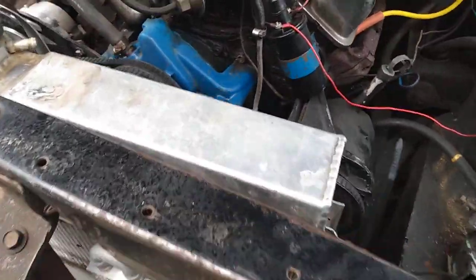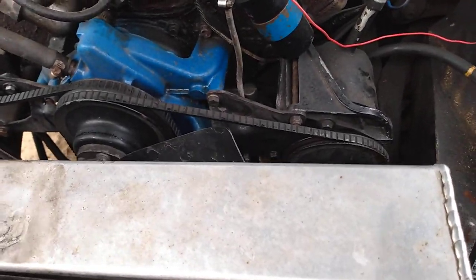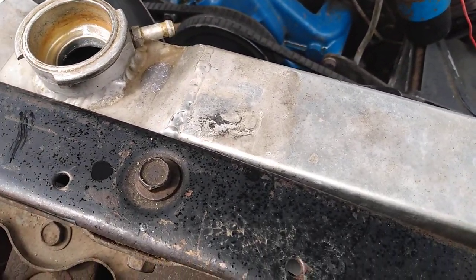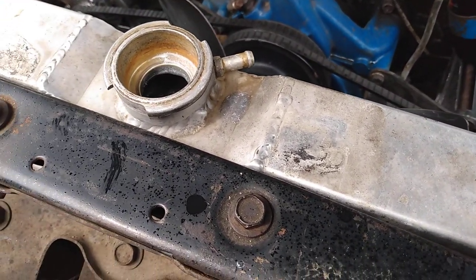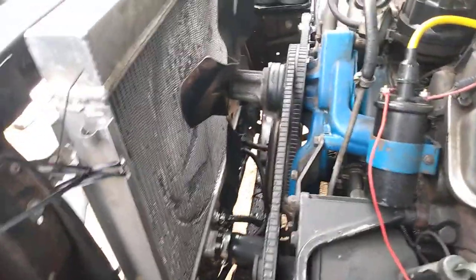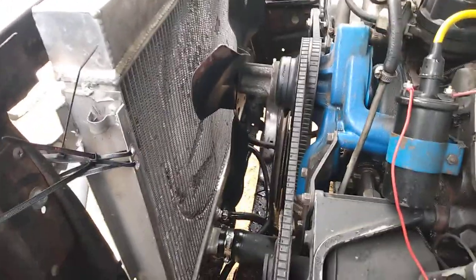Hopefully the radiator isn't out of water. Well, could be — yep, that's probably the reason. The radiator is very low on water and that's why it's not leaking anymore. Water stop leak is a decent product if you have a minor leak, but if you have several leaks like what I had in this radiator, it's pretty much toast — and I knew that.